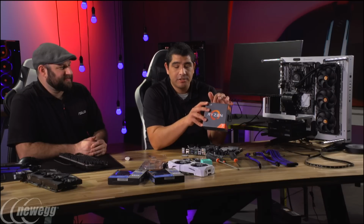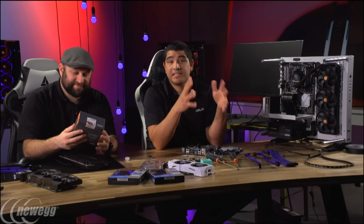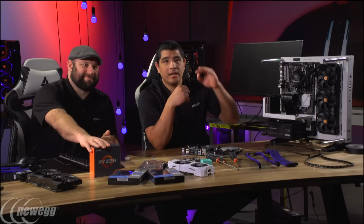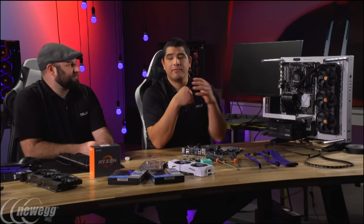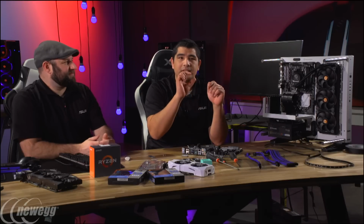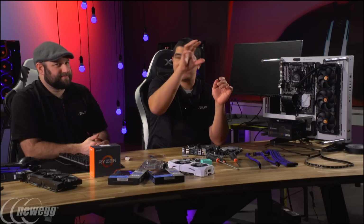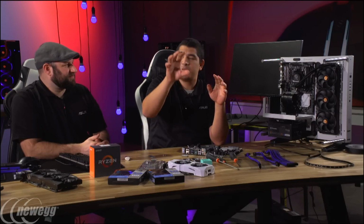Now what makes the 1800X so special is the X means that it supports a 100 megahertz higher frequency clock under XFR. XFR is essentially their special single thread real-time auto overclocking that, based on the conditions and the cooling, helps to extend that further. So if we talk about the base CPU frequencies, we've got 3.6 gigahertz as the guaranteed base clock. You then get a slight increase all-core clock of 3.7. Then there's this additional range that goes up to 4. And then with XFR it goes potentially up to 4.1.